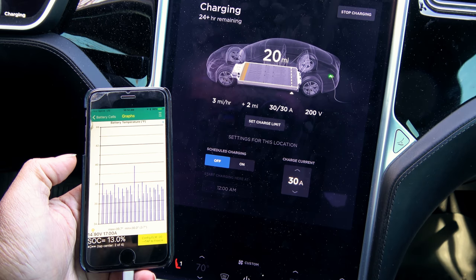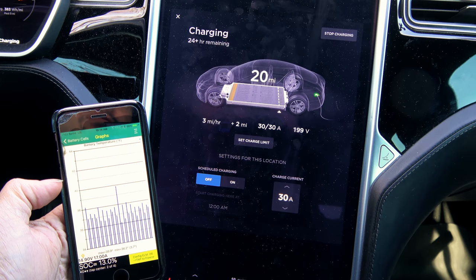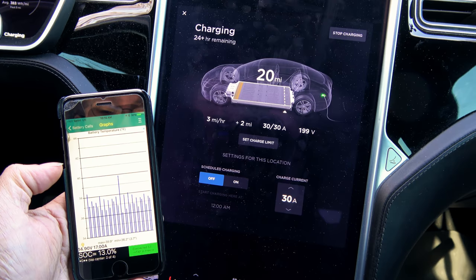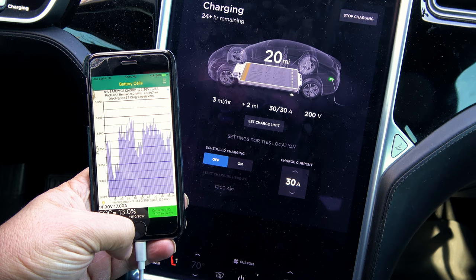There are military-grade and expensive lithium cells formulated differently that can be charged below freezing — I've seen one rated to negative 40°F, but they're very expensive. We've gained two miles back. The pack is now at 40°F high and 36.3°F low, charging at 6.6 amps — slowing down slightly.